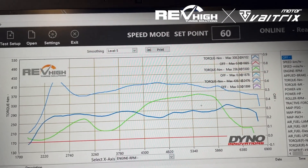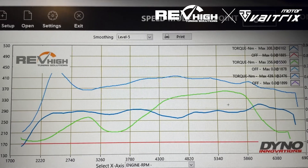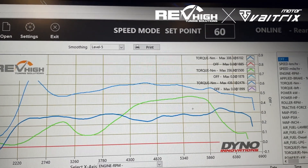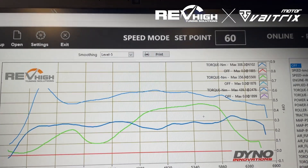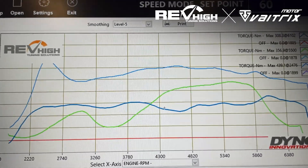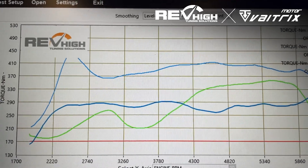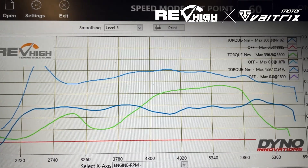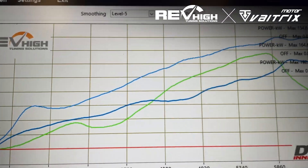If you are thinking to tune it and install the OTR the same day and drive it down to your local tuner, that should be okay. Just be aware that you are going to have these limitations. When the MAP sensor is moved, the torque management gets confused — it thinks you're making peak torque earlier than you're meant to be, and it starts retarding the torque and power and starts running rich. So it's just something to be aware of. That's what you're missing out on there in terms of kilowatt figures.